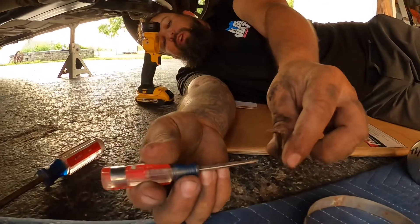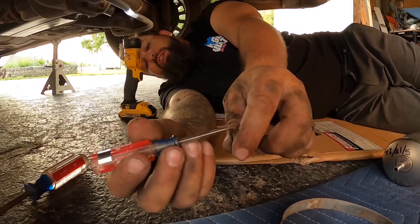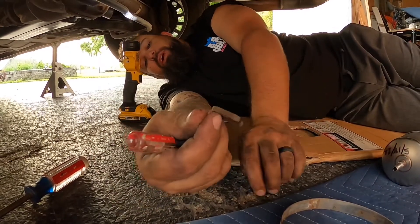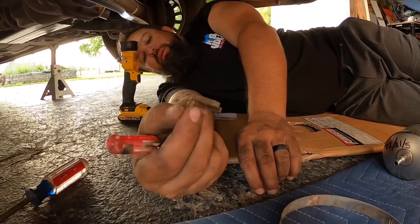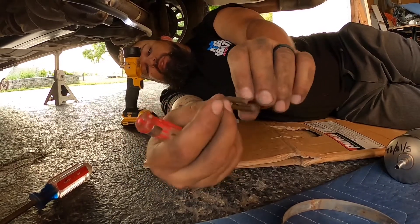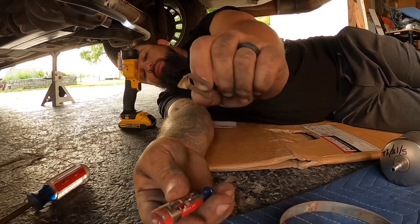This is the clip that you've got to pry off the fuel filter hose. Take a little flat blade screwdriver — you've got to just carefully work it left to right and then this thing will finally pop off. But if yours is like mine, original from 1990, this thing is very brittle. I already broke one of these, so we're going to have to go to the auto parts store and find one.